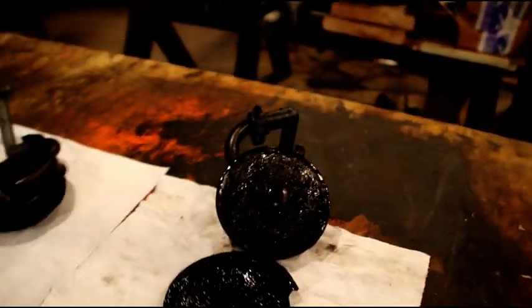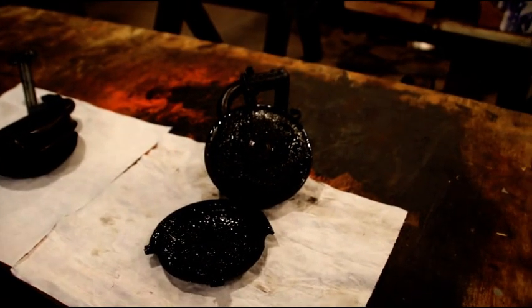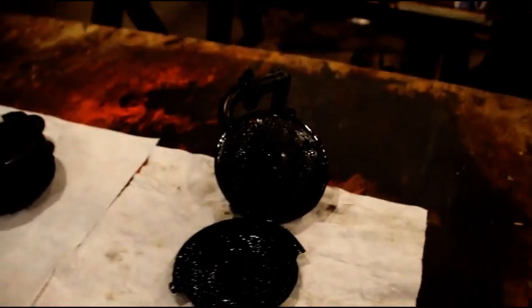Welcome back to the shop. I'm working on some Willys engines. What you're looking at is the oil pump pickup screen — I've got the plate off it. This plate covers the pickup, which screens the oil. This is out of Hal's engine and I knew it was going to be a mess. It's just full of sludge. Look how thick that stuff is — the screen is almost completely blocked up.